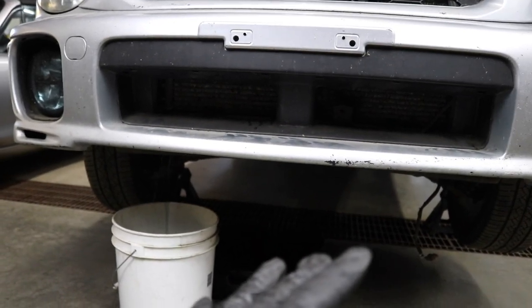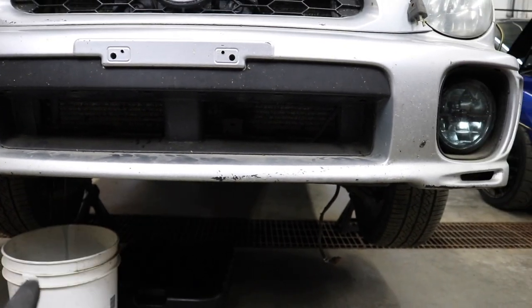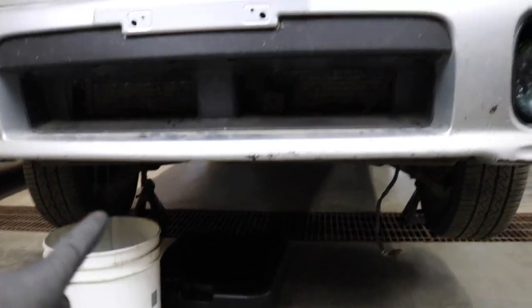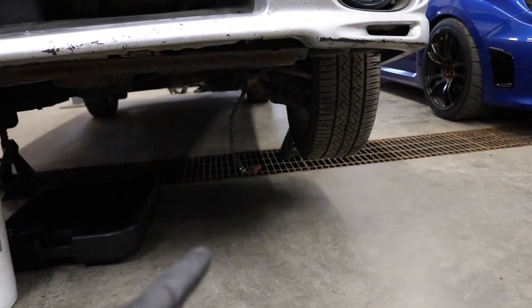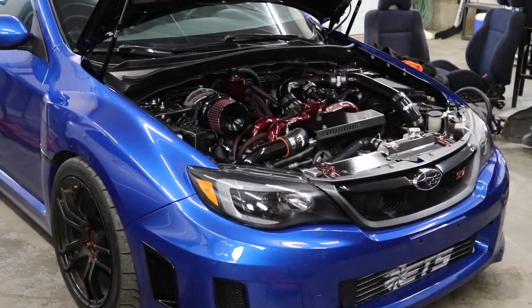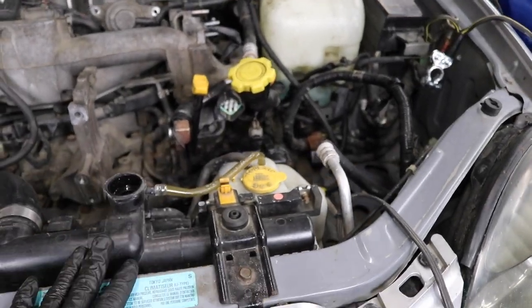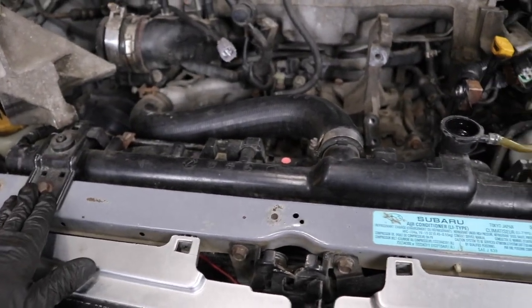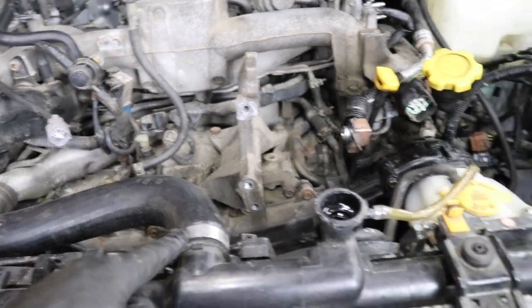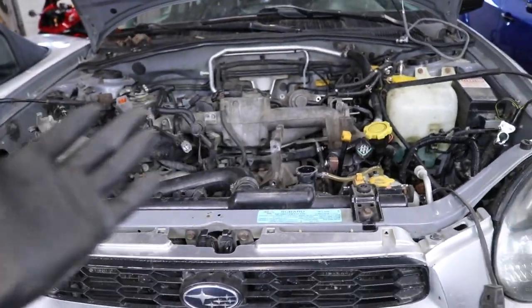Underneath, I took everything out: disconnected the rad fans, both engine mount bolts are out, both bell housing bolts are out, coolant is still draining, oil is still dripping out. I also took off the block heater cord — mine is mangled so I'll replace it with a spare from the STI. Now I'm going to get the two bolts pulled out for the rad supports, get the upper rad hose taken right out with both clamps off each side, then get the lower rad hose taken off down there and she's pretty much ready to pull.